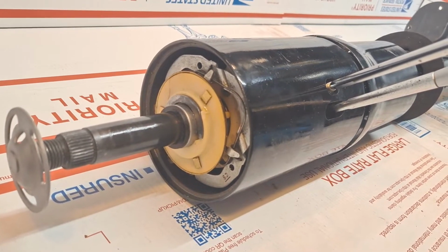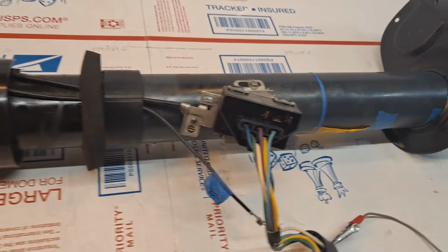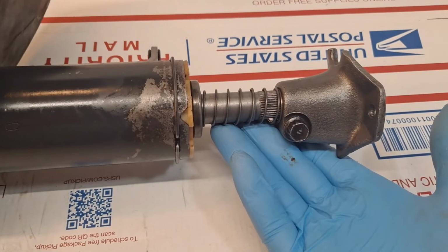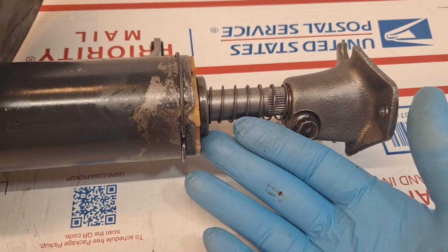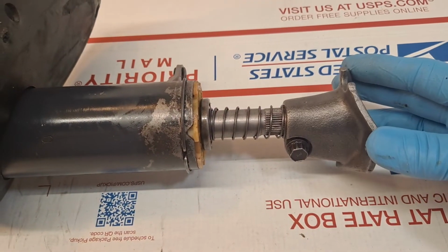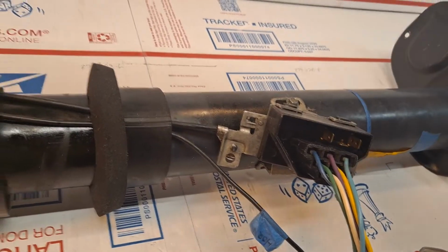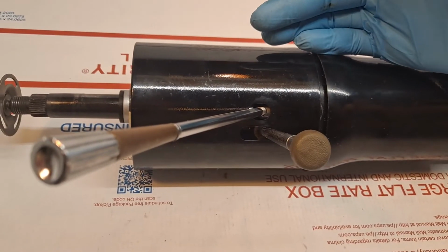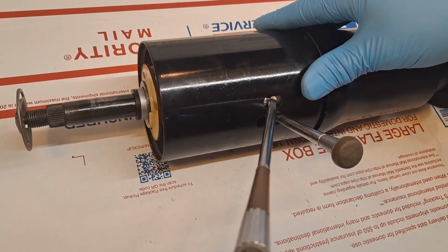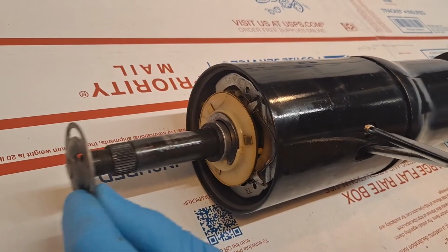In the predecessor video, out of this 2-video set, I had a complete bench layout of all of the individual components. And this is the fully assembled final embodiment. You can see how everything has been serviced, including the bearing set at the bottom, the internal splined shaft, the connection to the flex coupler, all of the electricals, the midsection half-round spherical balls that facilitate the tilting, the bearing set located at the mid-level height for the tilt, and the bearing set at the top, as well as the telescopic neck.